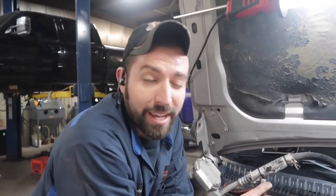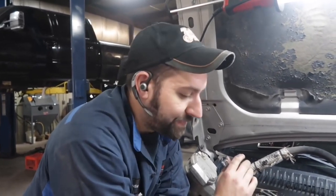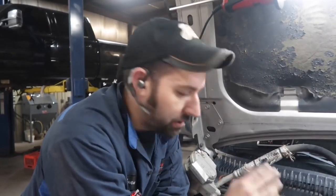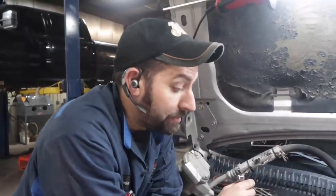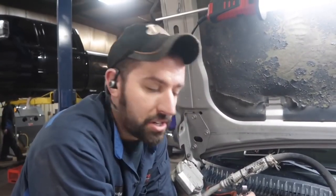You don't know how many times I've heard that's come back to bite guys hard before, so I cannot stress enough. If you're lifting that valve train up, take the hour it may take you by yourself to adjust these valves and make sure you have everything correctly adjusted. That can be detrimental to the motor. It will blow up if you don't have them adjusted properly and they're that far out of spec. Especially if you're taking your heads to the machine shop and actually having the heads milled.